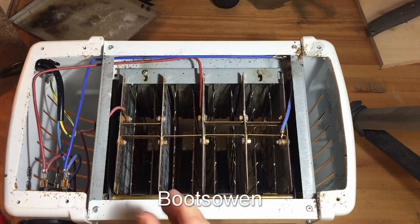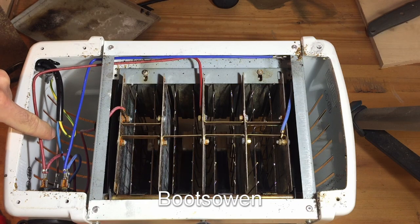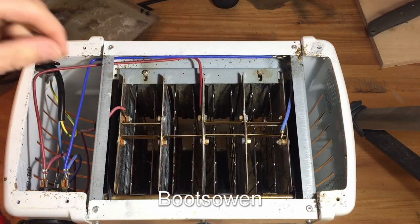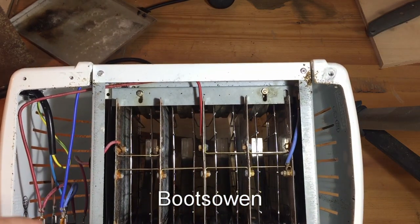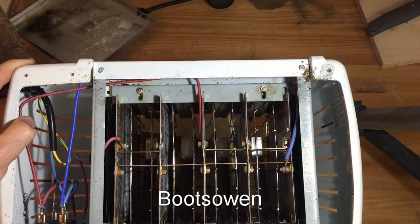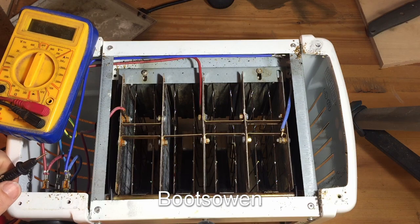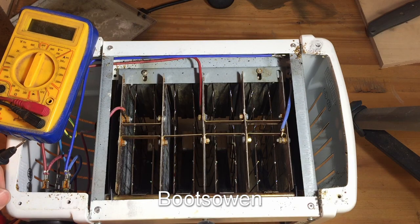Looking in here, it's a bit crummy. Over on the left, we've got a black cord — it's the power coming in, with brown and blue, live and neutral or line and neutral. Blue remains neutral throughout and brown is the positive or the line. I can already see in here there's brown marks on the electrical timer which looks like rust, and rust here and here — a bit of rust and corrosion. So it looks like it might have spent a while out in the rain.